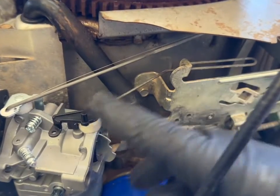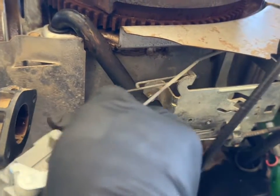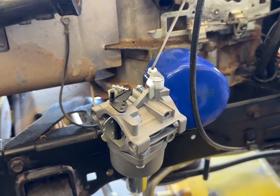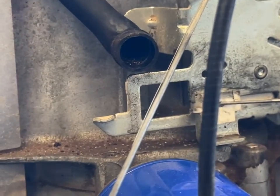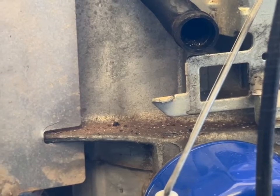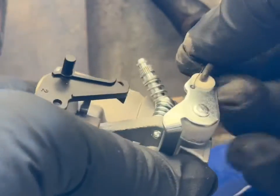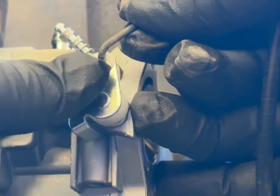On the choke side, the easiest way is to just slide it on through and pull the whole thing straight out — you can disconnect it from down here. If you look up here you'll see a secondary wire that is a return spring; it just adds tension. To remove it, you're going to twist it backwards and then it just pops straight out.